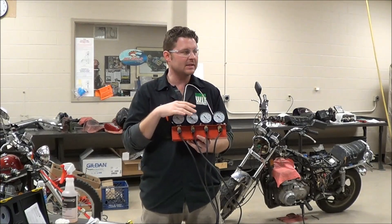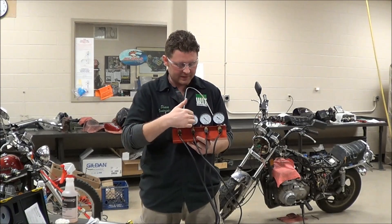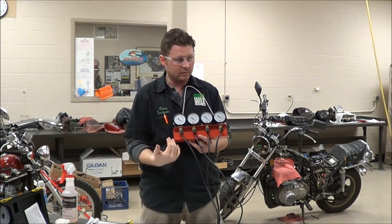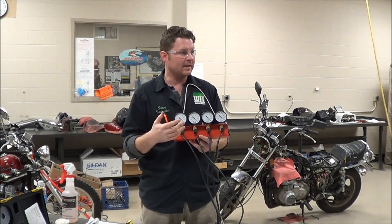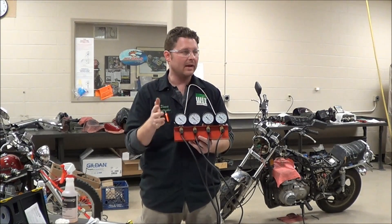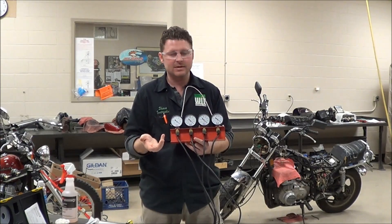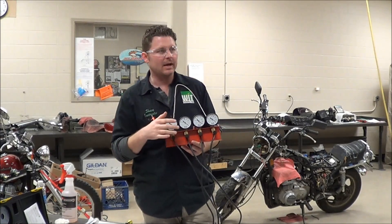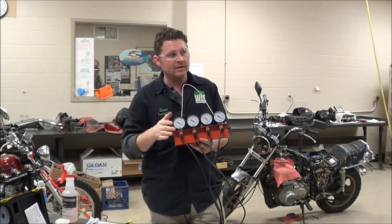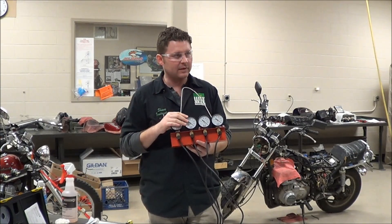What they're really doing is just seeing, are we close? If I put some gauges on there even when the vehicle's cold and this one is way out in left field, it's going to make sense that yes, I need to move forward — I'm way off. Even when the engine's cold, if the gauges are real similar to each other, there's probably a pretty good chance that they're synced. But make no mistake about it — read the manual. If the manual says to run to full operational temp, then that's something you would definitely want to do.